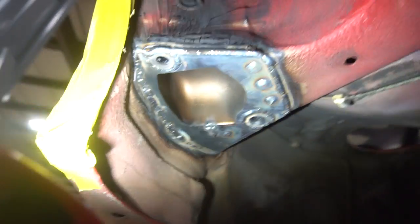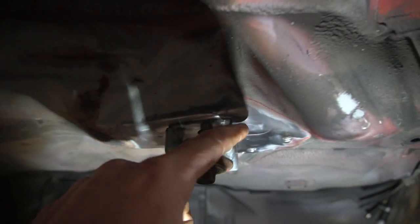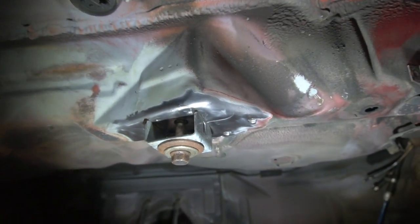It feels like forever later and one ruined hoodie later — all the mounts are fully welded in except the pieces that are broken. This corner is ridiculous — I kind of over-welded it. Brian just got out of work and we started going ham on this broken piece. It was actually smushed up a little bit, so I made a little U-bracket to pull it down and Brian's massaging it with the hammer so it will stay in position. Once we get this into the correct shape, I'm going to weld all the cracks, make it structurally sound again, and then weld the plate on top. I'm very fortunate the upper spot welds didn't break — that could have been a way bigger job.